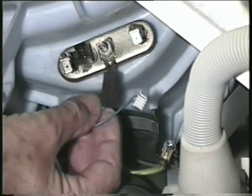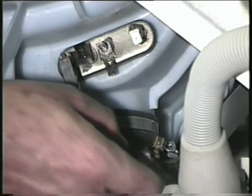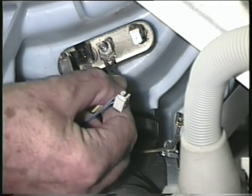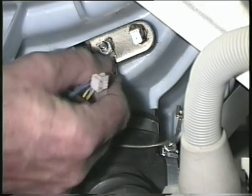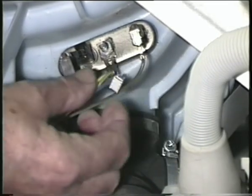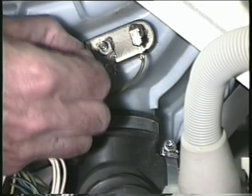As long as the earth wire to the heater — the green and yellow one — fits on the terminal attached to the bolt, the other two wires with spade terminals on can fit either of the outside terminals on the element. The thermistor plug only fits one way in the housing and this one is held in place by a little spring tab.